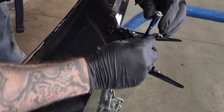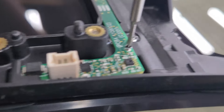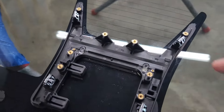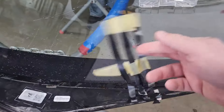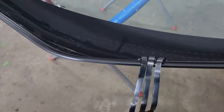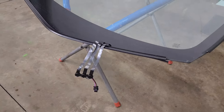Jeff has to unscrew this little computer board — that little sunglass-style screw — and that computer board gets changed over and put into the new window. So you can't throw those old windows out just yet, or you'll be dumpster diving to get it back. If you're wondering what this mess of wires is, that is your heated wiper park area. This one has a nice brand new end on it. Your heated wiper park area runs across the whole bottom — there are defrost lines. Some windows you can see them, some you can't. What it does is keep your wipers defrosted when they're in the off position so they don't freeze up. A lot of newer cars have this, not just Tesla.